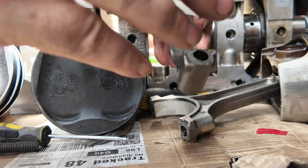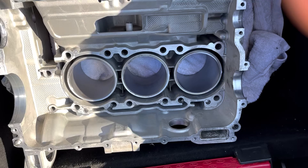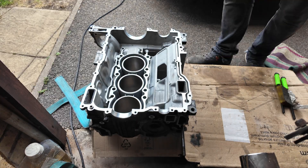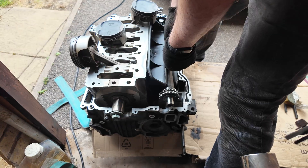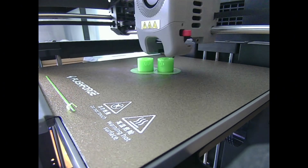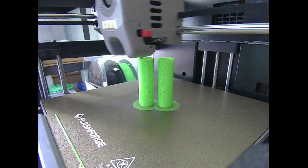When we've finished this, we're going to lift the whole crank carrier into the new case. There's the case with the new cylinders in there — two new cylinders, the center one fairly new as it was, so that whole side has been replaced. I did forget one of the changes so I had to redo it. You're supposed to use Porsche tool 9613 to hold the crank carrier to the case — I haven't got that, so I'm going to print one off.